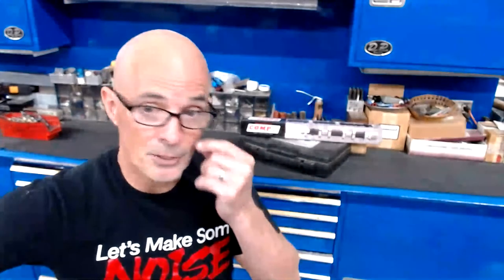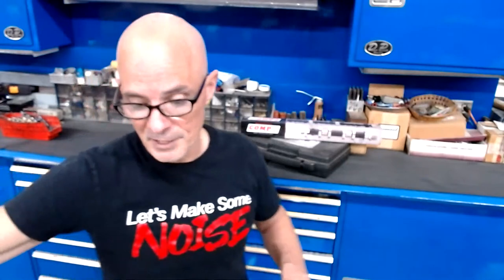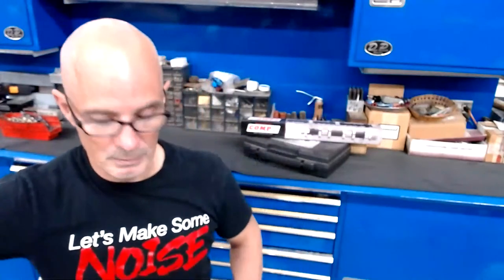You have a lot of things there, Ahmed. I just need to know the inducer and exducer diameters of both the compressor and the turbine to give you an idea. If it's a 69 millimeter turbo, that's like a GT45, it's like a 700 or 750 horsepower turbo. Yeah, the bolts are really small. I've already put a 5/16 in there. I just don't know if I got the thread pitch right. It's a fine thread.